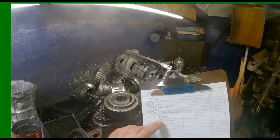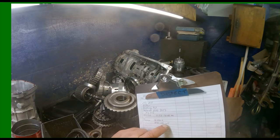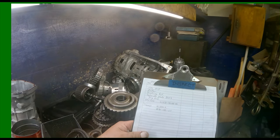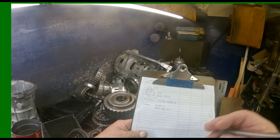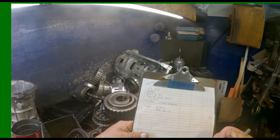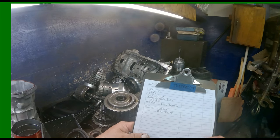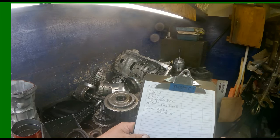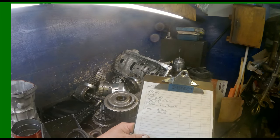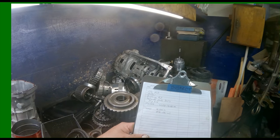SK6R80-A. Those are drop-in valves. This 6R80-VBR-WT. That's the valve that wears out, that causes a lot of this, and it comes with the reamer. So future kits, I wouldn't need to buy the reamer, I'd just buy this valve. But I'm not sure how they're going to want to go here. They might just want to buy a valve body, and we wouldn't have to buy the zip kit or the separator plate. And plus we'd get solenoids and everything on it.